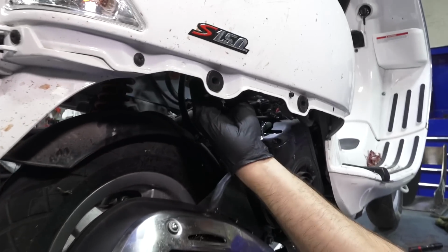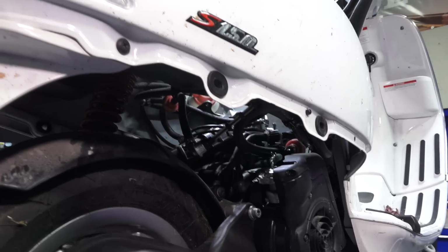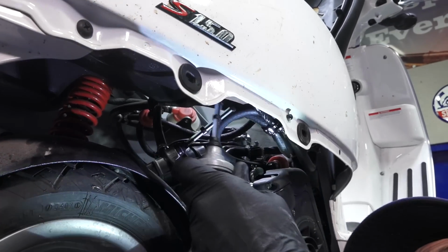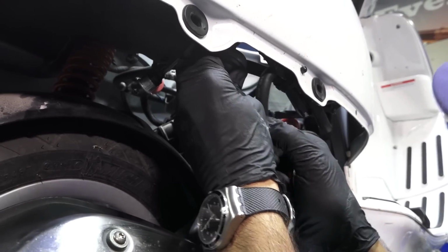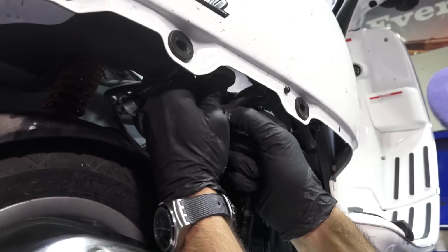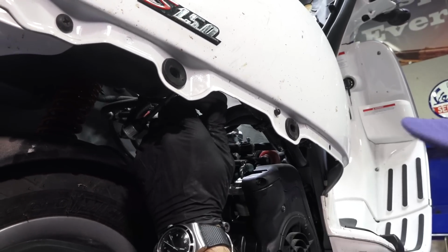You know, you could loosen it. Looks like a regular hose clamp, and pretty much just like the reverse, we'll put the new fuel tap up in there and then tighten the clamp to get the old strainer out of the way. And ironically, I checked that strainer. For some reason, it wasn't even flowing gas, so there might be obstruction in the fuel line. And the other important thing is you want to have the lines kind of point towards the carburetor.